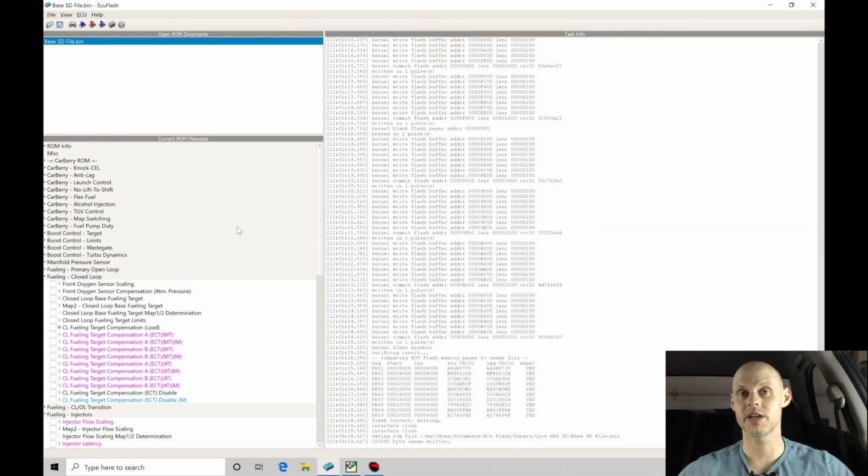Welcome back to our live training session here with our 2003 Subaru WRX. In our last video, we built the base calibration file to start off this video with to get the engine fired up and running. Going back through just to recap what we did in the last video, we went in and made the spark timing extremely conservative. We turned the boost all the way down to the base wastegate actuator or spring level, if you have an external wastegate or an internal wastegate. We're trying to run the lowest boost possible and really low spark timing.